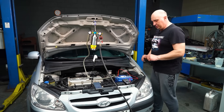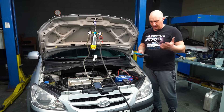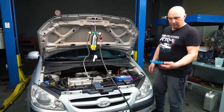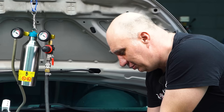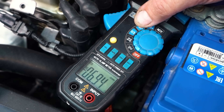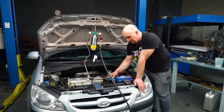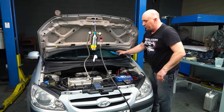I'm interested to check what sort of current the electronics are pulling — something I've never done. I suggest we take this specialized clamp and fit it to these wires. The current is fluctuating: I'm seeing 7 amps, then 6, 5. Perhaps that's just how the meter is calibrated. The average figure is about 6 amps. Remember that. What I'm really interested in now is to see how long the engine lasts.